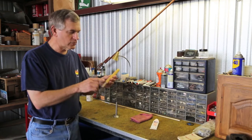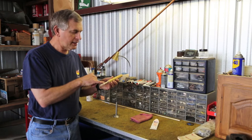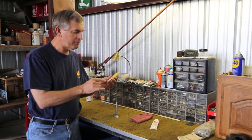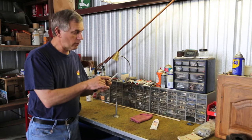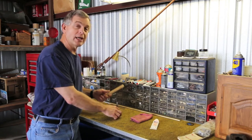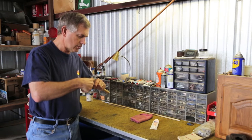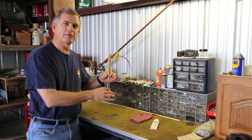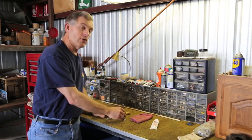I've made this nifty little tool out of a piece of a broom handle. I drilled into that a hole 3/8 inch diameter, then glued into that hole a piece of 3/8 inch dowel rod, and over that I put a piece of 3/8 inch ID plastic tubing along with some safety wire around it to make sure we have good contact and the tubing won't slip on the dowel rod. Why 3/8 inch? Because that's the diameter of the valve stem. I put the valve stem into the tubing — slide the tubing down over the valve stem with a little safety wire to keep it from coming off. Now I can pull up and grind on the valve at the same time. Let's go do the repair.